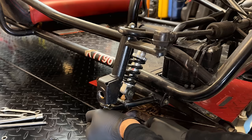We've got the multimeter right here connected to the battery. We're starting at 13.13 volts. So when I crank the engine, the voltage is going to drop and recover. Now, hopefully it keeps going beyond where it is now. I want to see the voltage climbing if the charging circuit's working.